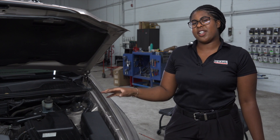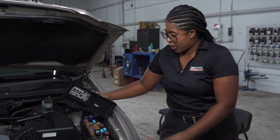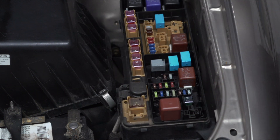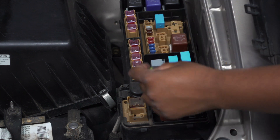With our wiring completely installed, we need to make sure it has power. To do so, on our driver's side, we're going to lift up our fuse box and check to make sure the towing fuse has power. You should have a 20 amp fuse located right here. Ours does not, so we will place a 20 amp fuse inside.